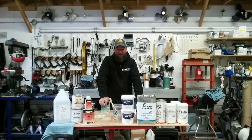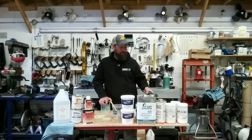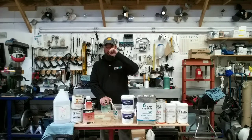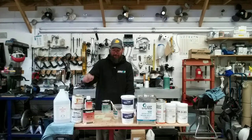That covers all the materials we used. Not much in terms of equipment — a lot was hand sanding. I used a longboard, a 3-inch orbital air sander, a Festool for the initial knock-down, an air tool with burrs, and a 6-inch air sander for the final sand before primer, base coat, and paint.